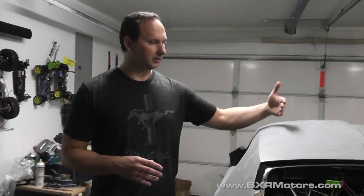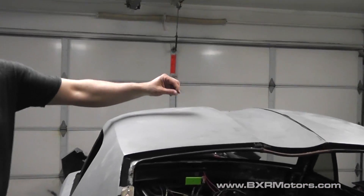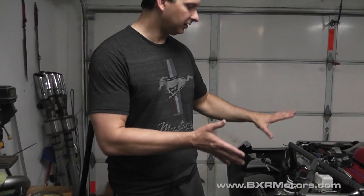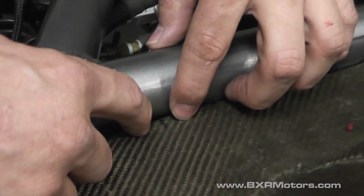At the same time, we're centering the body onto the chassis. It's centered in the back but off a little in the front. Basically the body is over to the left, the driver's side, about a quarter of an inch at this location, but by the time that quarter inch translates up to the front it's off by about an inch. So we're making changes to the body to move it over - we've already moved it a little bit, and we really only need to go about three quarters of an inch in this area.